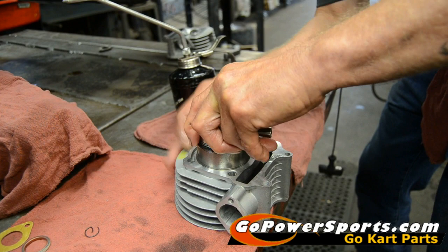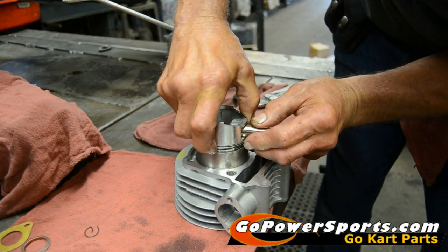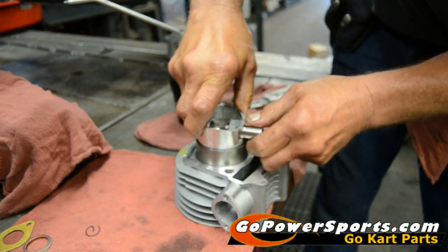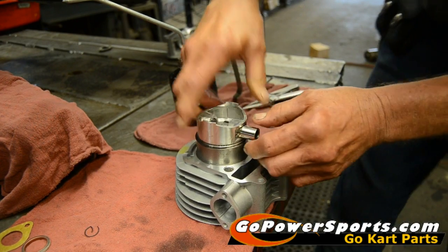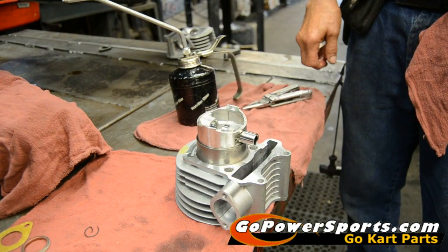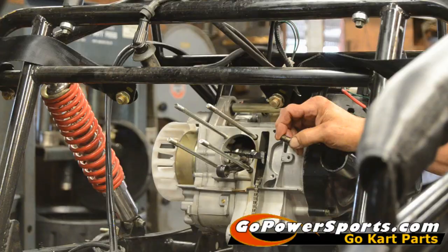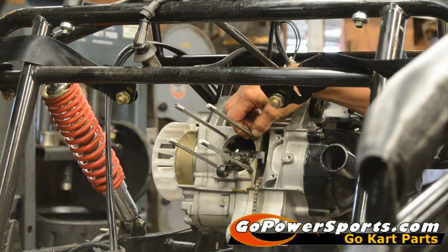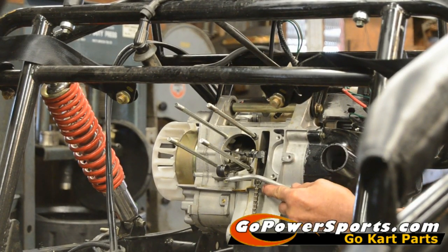You can just lightly tilt and push in on these rings with your taper on the new cylinders and lightly just tap them down into the hole. Once you do that, take the base gasket and install it on the block of the engine. We've already cleaned our block surface. Scott's reinstalling the dowel pins — there are two that go between the cylinder and the block. We've shot our gasket with Hi-Tac, and then we're going to oil our wrist pin.